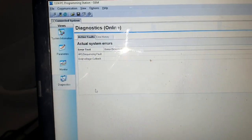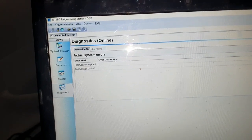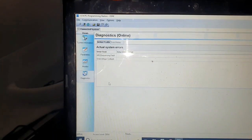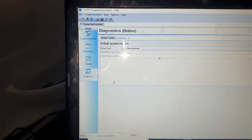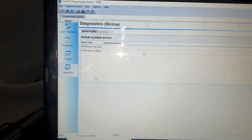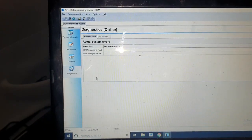I did see something stating it was 60 volts, but there was a 10 volt leeway for severe over voltage, and I was hoping that was going to give me the leeway in order to drive it. But unfortunately I think it has cut back the voltage due to that being over 60 volts. So I don't think there's any way around it on this controller - I've had a look at the settings and I really don't think there's any way around it. So we'll just have to see what we can do. As long as I can get the car running for now, I should get around 30 to 40 mile range out of it, so it's not terrible.